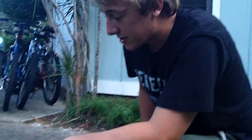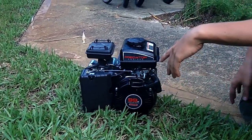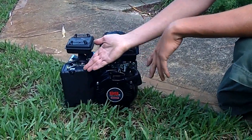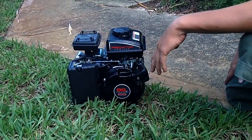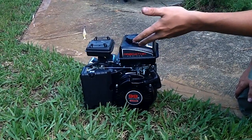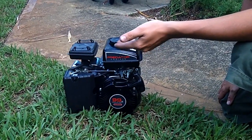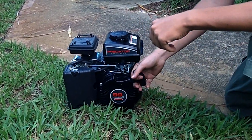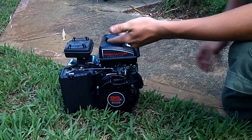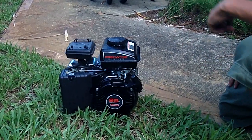That's very important if you're going to store an engine outside. If you don't have it on TDC you run the risk of having an inlet valve open, and if rain gets in it's going to go into your engine and rust it up and maybe seize it. That actually happened to me — I had the bigger Harbor Freight engine, the 212, left it outside without an air cleaner on, which was stupid, and rainwater got in and seized it up. So always make sure it's on TDC to stop anything getting in, and also so nothing crawls in through your exhaust.